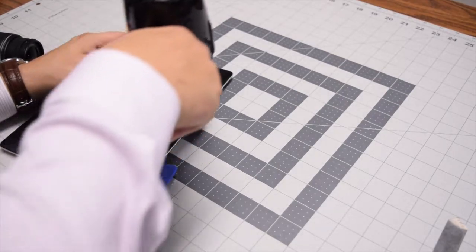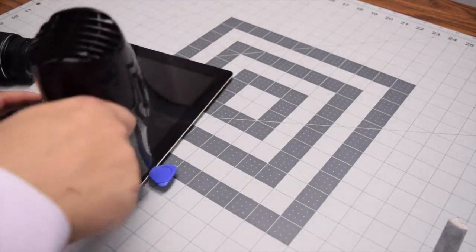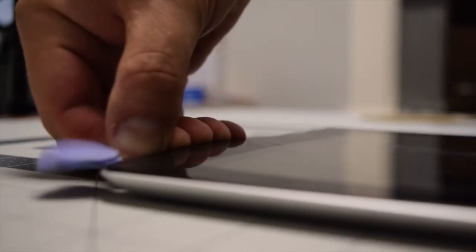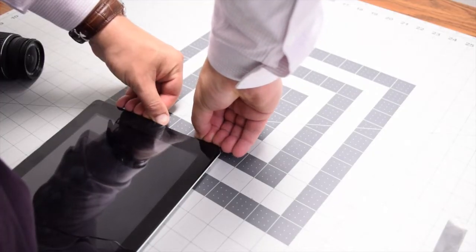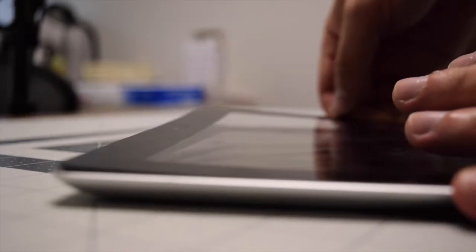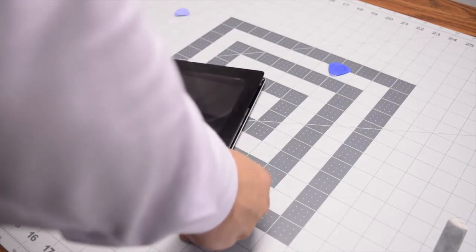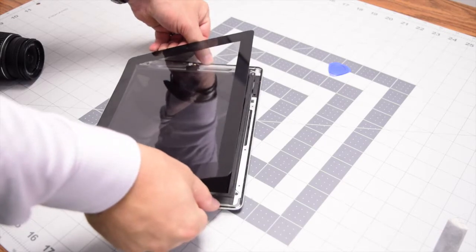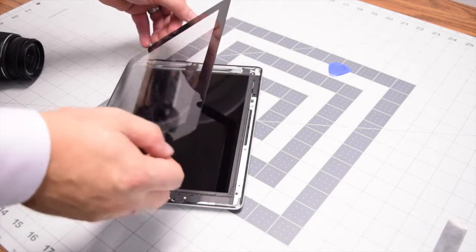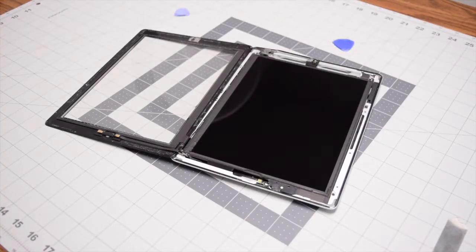Don't rush — this takes a lot of time, reheating again and again. If you go too fast you might crack the screen. Once you've got it going, start prying it apart very slowly and it should come right out. Breaking the seal is very difficult without cracking the screen, so if you're replacing other parts, order a replacement screen just to have on hand in case you crack it.